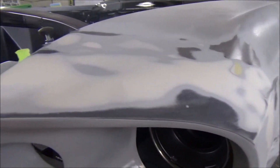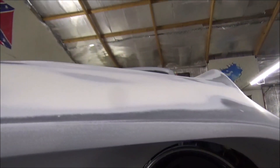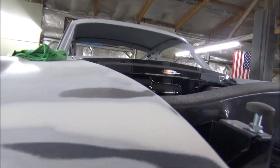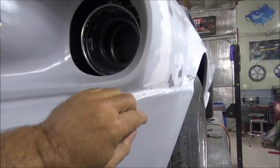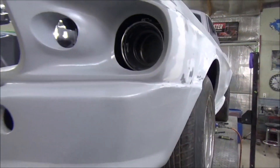You can see how this works out - here's the top right here. I'm already down to 240 on it and I mean it's slick, it looks great. See how it contours up - there's no low spots, there's no high spots. That eye should really get the particulars done on that thing. This is how I look at it with my eye - I come down here and start going up, up, up. Feel across there and see - that's coming along really, really good. Our seam here looks pretty great. I'll take some of the icing and that'll just get some deep sanding marks and such as that and take care of them.